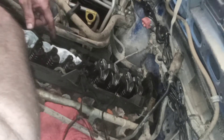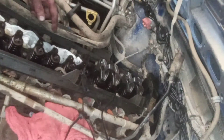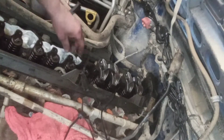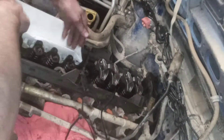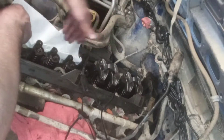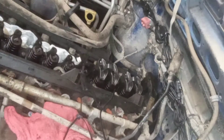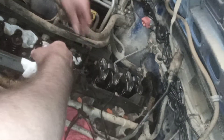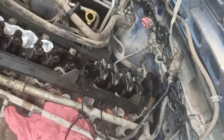While I was cleaning all this out it took a really long time to clean this up. I don't want to get anything down in those holes where the lifters are, where the push rods go through. So what I did was I took a paper towel like this, folded it, and tucked it down — two holes at a time — and every two holes I had a new paper towel. It kept all the dirt out. Just a little trick.